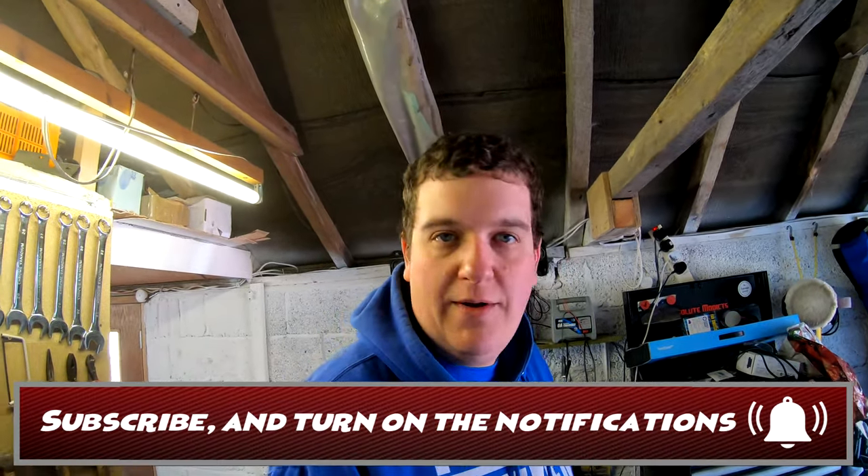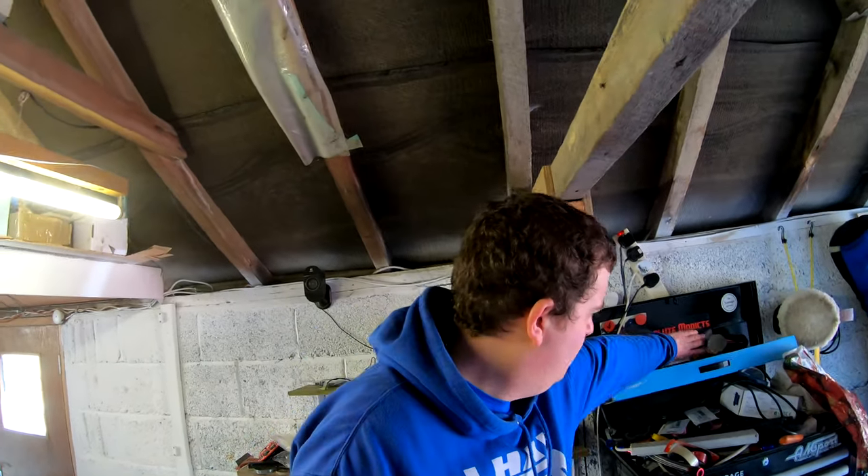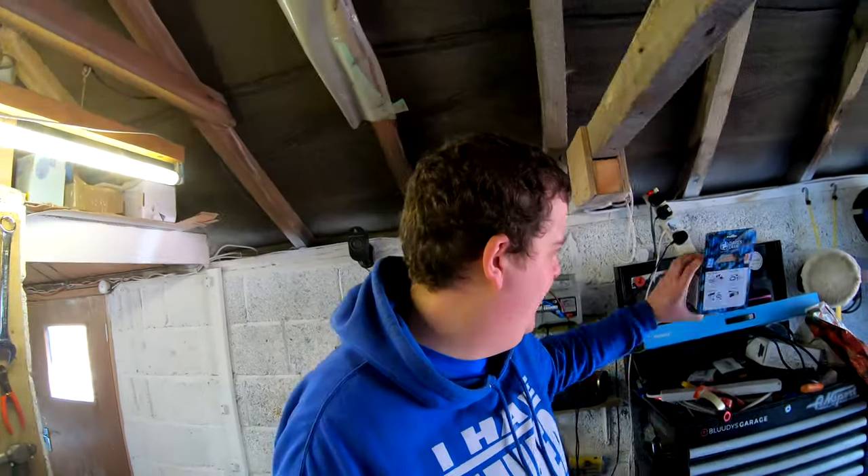I want the car to be a top performer, so we are refreshing all of the cooling system. I showed you in the last video all the new hoses and clamps I've got, and I've got a digital thermostat gauge — a Davies Craig thermostatic thing — and we'll be fitting that in another video. But today we'll be draining the cooling system, changing the water pump, changing the thermostat, and all of the pipes.